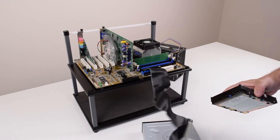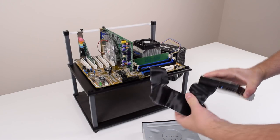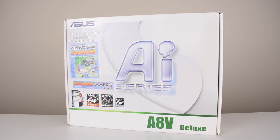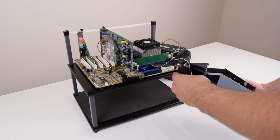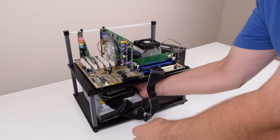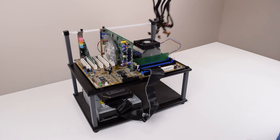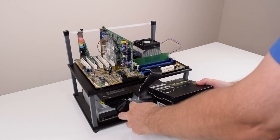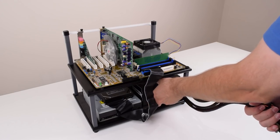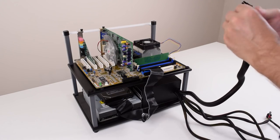Before putting everything into a case I like to build these retro systems on a test bench. It's just a lot easier to work with and I can swap parts really quickly. So we start with the motherboard. There are lots of options — it can be either socket 754 or 939, but it has to have an AGP interface as this will let us use a huge range of Windows 98 and DOS compatible graphics cards. The chipset is also important. I wanted to use one from VIA. Motherboards with VIA chipsets are easy to find, the driver support for Windows 98 is very good and it also works great with the sound card we are using. The board I'm using for this project is the ASUS A8V revision 2.0 with the K8T800 Pro chipset and the VT8237R Southbridge. I've used this board in a few projects already, it always worked great for me. It's got a nice layout, has a metal CPU backplate and all the BIOS options that we need for this project.